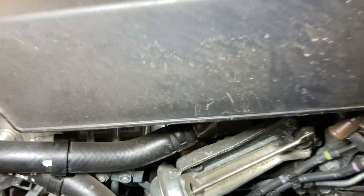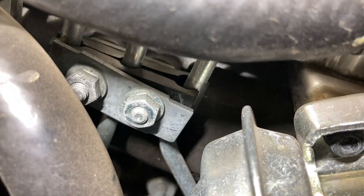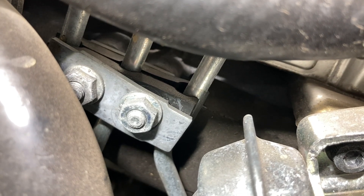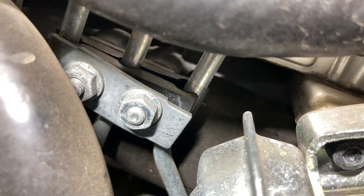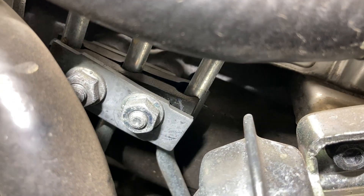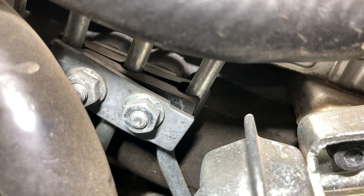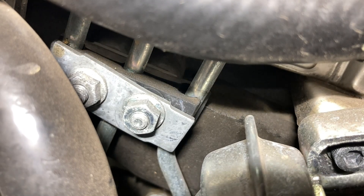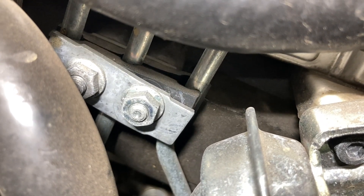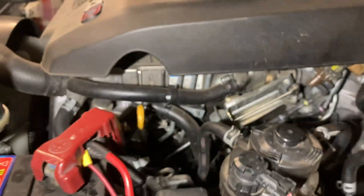More evidence on this side - look at these clamps, that is just ridiculous. You've got one plate at the back, then rubber, then rubber, then a plate at the front - two clamps sold separately, about $10-$15 each side from your local Toyota dealer. The studs and nuts go through into the manifold. In this case it's all there, just hasn't been fitted properly. All you need to do is loosen the nuts and slide that alloy plate upwards - we'll go ahead and fix both those clamps.